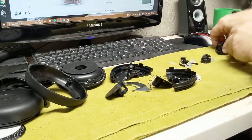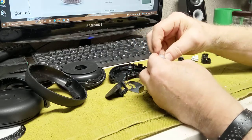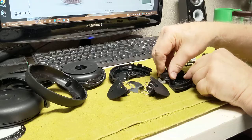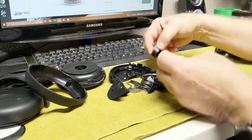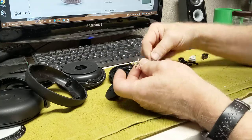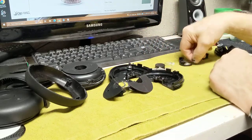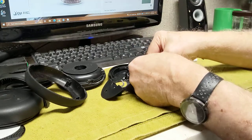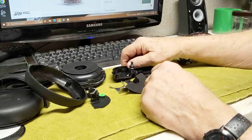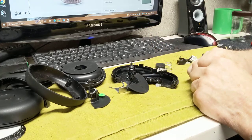To release the vacuum, there's a little rubber piece that fits over the center. When you push down on the button, it opens up this little rubber piece and lets the air out — that's what that part is. It has a spring that pushes it up and down, which is how the button moves. There's also a little retaining ring that fits around this to hold it. Like I said, they all snap together and there's not much you can take apart. That's really the workings of it. If you have any questions, let me know in the comments and I'll try to answer them. Thank you very much.